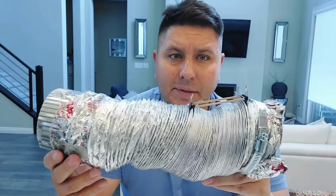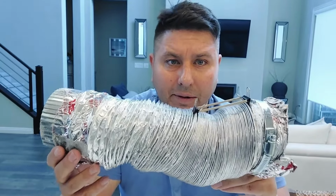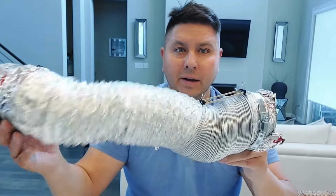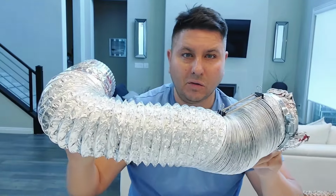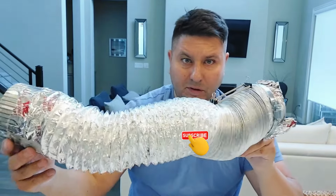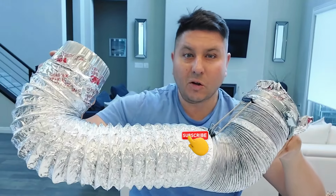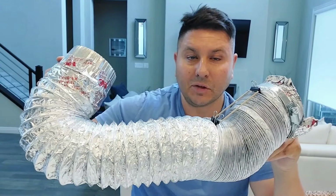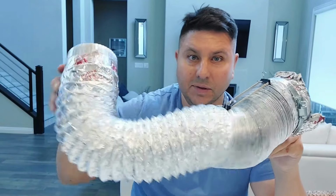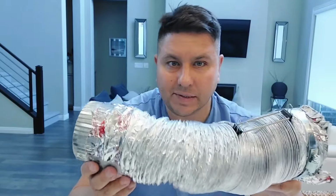But usually what happens is people drop a sock or something behind the dryer and they need to get back there, so they move the dryer. They're in a rush doing things, and this vent ends up too long in the back. If it's long like this, your clothes take an extra long time to dry, maybe 1 or 2 cycles. And for those watching this video, maybe your dryer's broken and it takes like 3 cycles to dry. Towards the end, I'll share a secret on why that's happening.